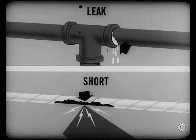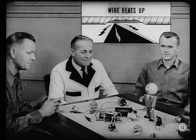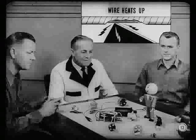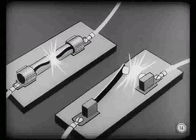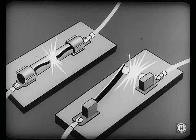To correspond to a water leak, there's a short or an accidental ground. Shorts aren't too hard to locate — the wire heats up and insulation starts to burn on the shorted wire or unit. But before there's any serious damage, a fuse or circuit breaker disconnects the shorted-out section from the source of supply to protect the system. And that's where we have to start checking out the circuit.